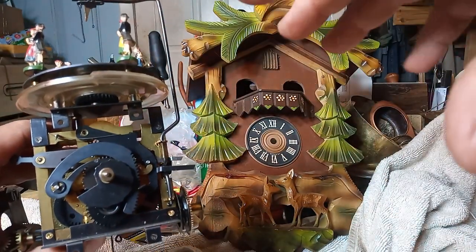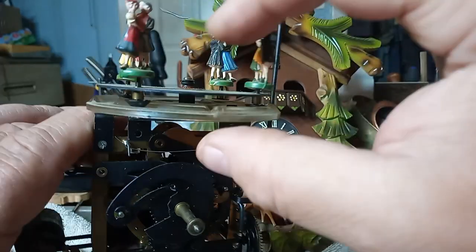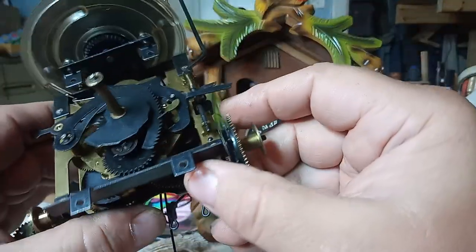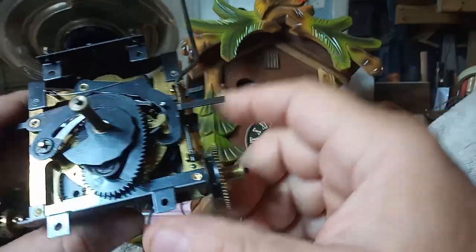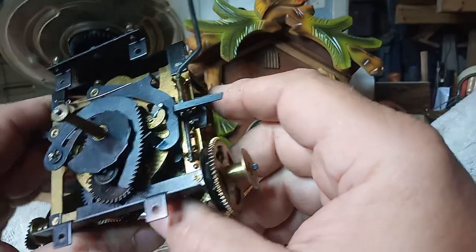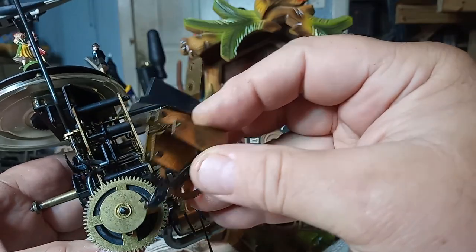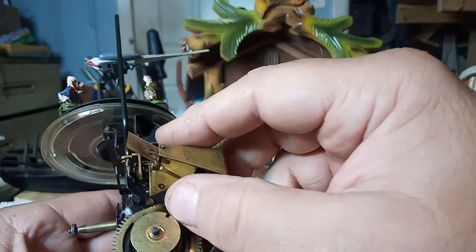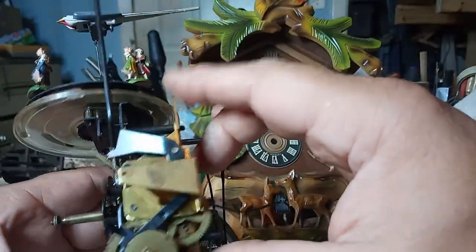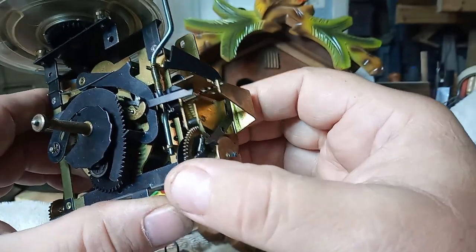they take that star clip that goes underneath this E-clip to hold this platform down. And then you want to make sure that this and this are not bent, because if they are bent, they're not going to lift up the assembly. And all you got to do when you put the assembly on is, when you put it on, you want to put it on so the gears match up and that you could turn it easily.